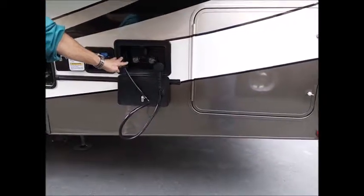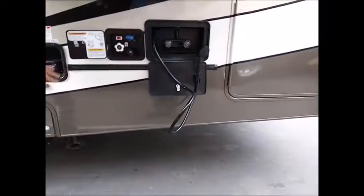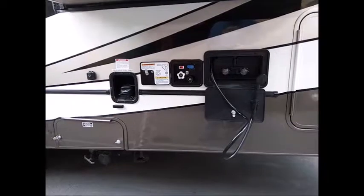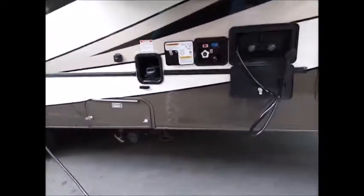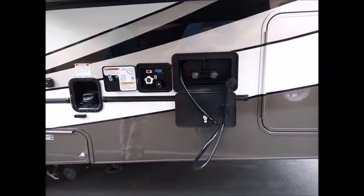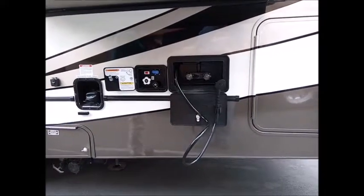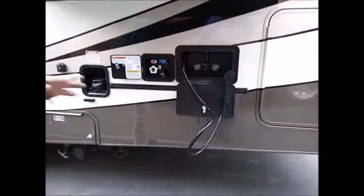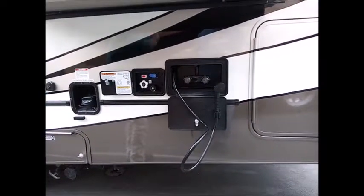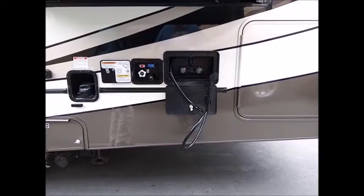And someone has left this knob on. Everything I'm going to tell you right now is here. The biggest thing I can tell you is, at least they color coded it. Put something right here like a skull and crossbones, because so many people take their fresh water hose and, instead of hooking it up to the city water, hook it up to here and turn it on. Pretty soon, the holding tank's laying on the ground underneath the trailer.